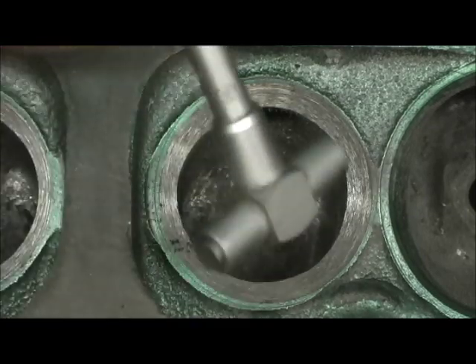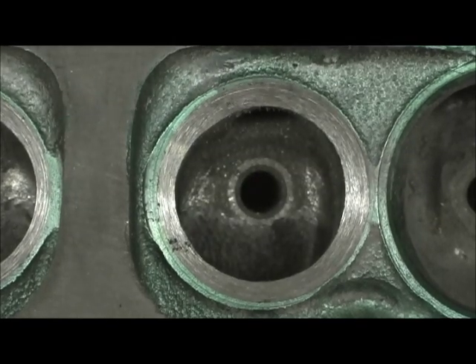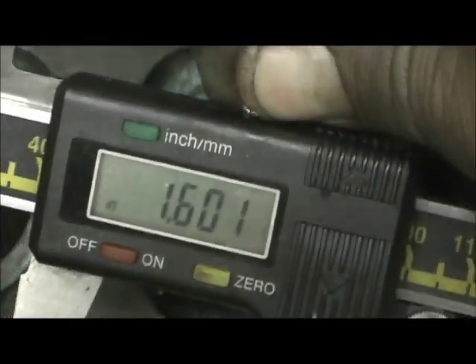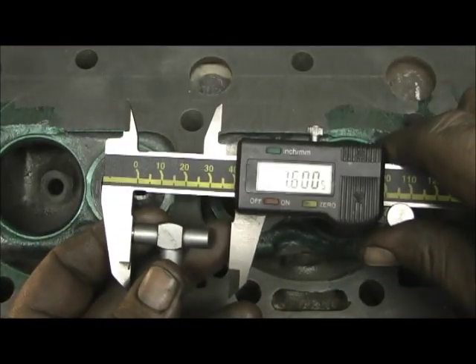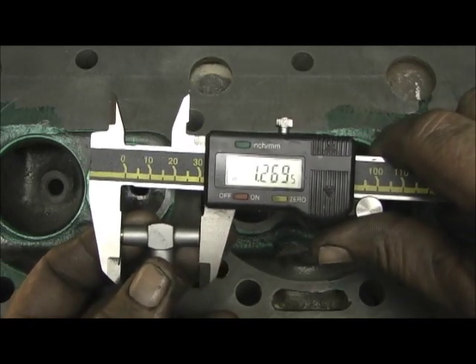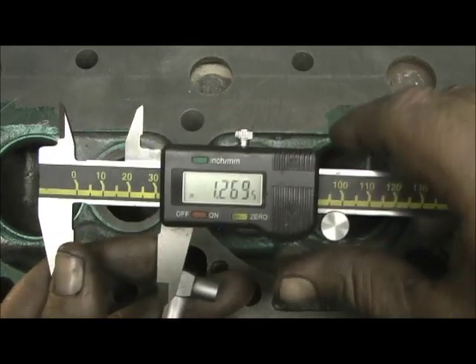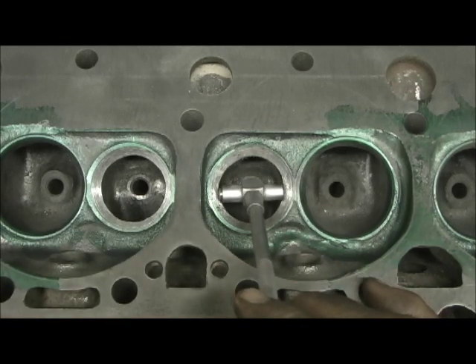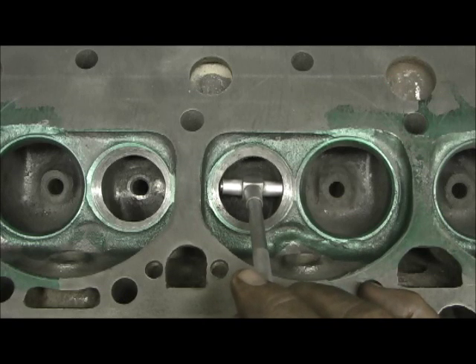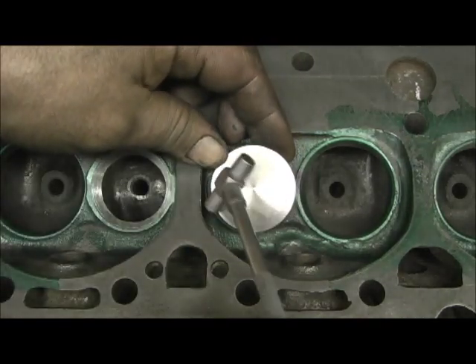Here's the part that's just going to knock your socks off. When we go in here and measure the diameter going across the board — we go down from the 1.60 — it's 1.269. That is a major difference. So this diameter here is all that the airflow is seeing when it comes up. It's not utilizing that valve; the only thing it's doing is getting a little venturi trick which might pull a few numbers, but not much at all.